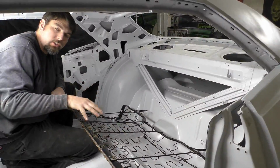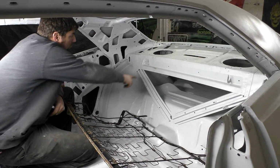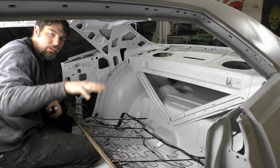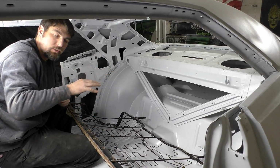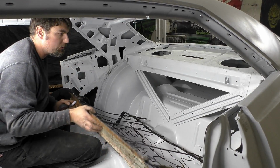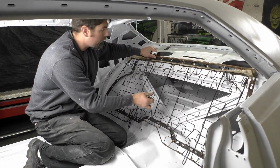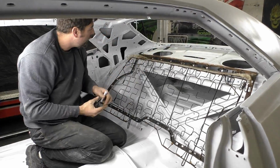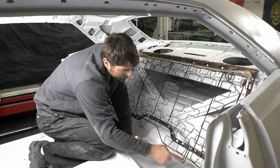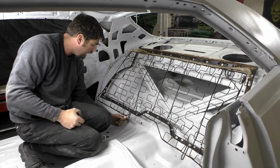So now we're going to install the seat like we would normally in the car, without the cover, of course. You could see there's going to be hooks there on both sides, and they're going to go into the hooks up here. So even if you don't modify the seat, this is the idea on how to install a rear seat on an E-body, and really most of the muscle cars are the same way. So the first step, you always install the back of the rear seat first, and you've got the two hooks. They slide in there, and you see it kind of just sits right across the back package tray. And then the idea is down here, these get pushed down, and there's screws that hold them in there through the bottom.